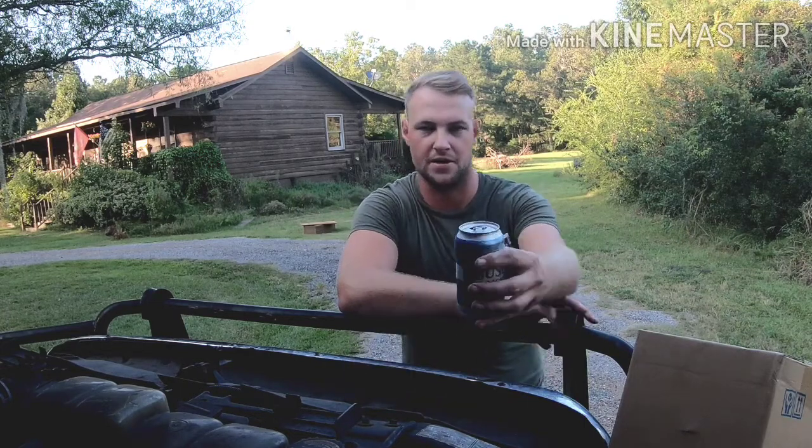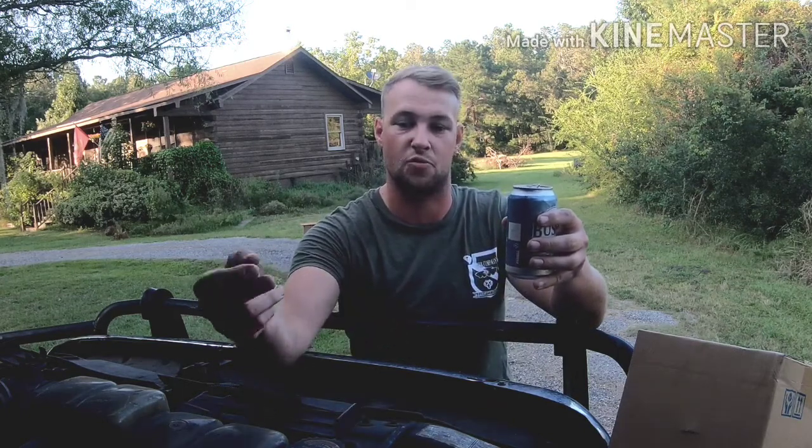So if you're here, your blower motor has gone out. I'm also going to be tackling the problem where your selector switch for your fan speed isn't working. That's actually a resistor that we're going to be replacing as well. So I'm going to replace the resistor. I'd highly suggest getting the plug as well. It's like an extra $4, $5, and off Amazon, of course.